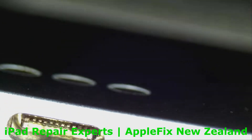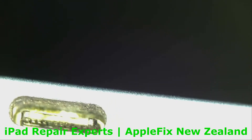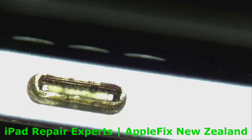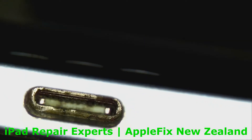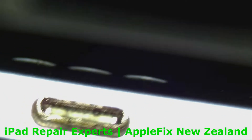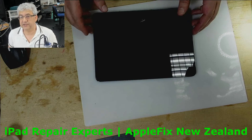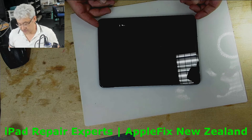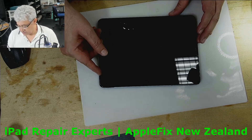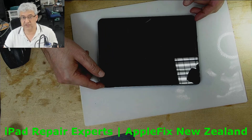Okay, do you see? Even though the lines look intact, it's burnt. So to me it looks like the charging port, but you never know. As you may have seen in my last video — that was about an iPad charging port, the fifth generation — we initially replaced the charging port and then it turned out to be the charging IC as well.